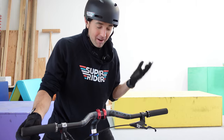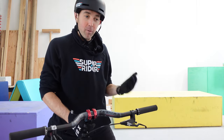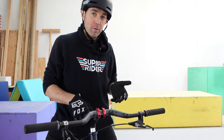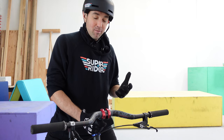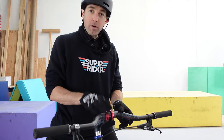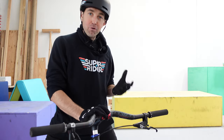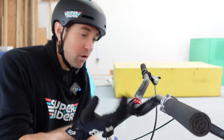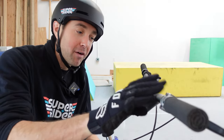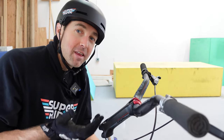So I think we've found the limit here. This feels way too extreme, although not terrible. I think if I was trying to do a lot of front wheel stuff, this would be great. It just feels like the bike is now unbalanced because all of my weight is far forward and I'm not getting anything on the back wheel — I have to do a lot of work to get to the back wheel. So we'll rotate this back to almost the opposite extreme to see just where we're going to fit in. You can see here how much we've actually rotated these bars back because now the levers aren't pointing straight down, they're pointing straight out.